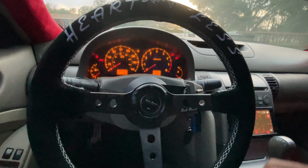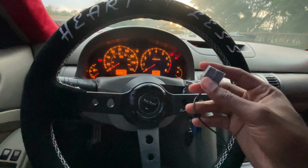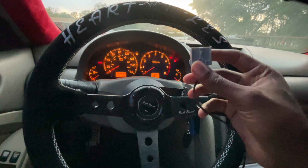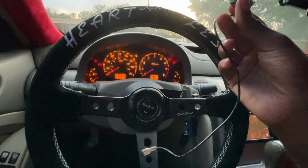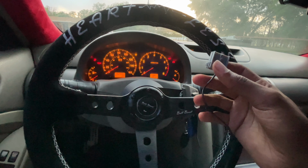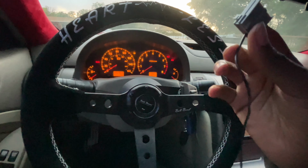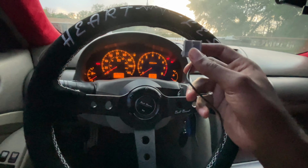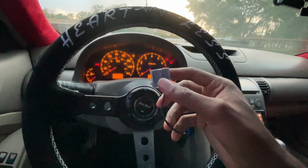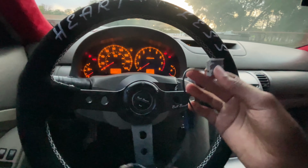So all I would have to do is depin this wire and replace the green wire that's in there, and depin this into the spot that the green wire is in, and ground this wire. So everybody been doing, I ain't gonna say they doing it wrong, but they doing a lot of work. And the only thing you gotta do is depin this from this and pin it into the green spot that is pinned on the steering wheel on the inside of it. That's all you gotta do. I just had to come back and tell y'all that.